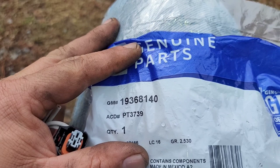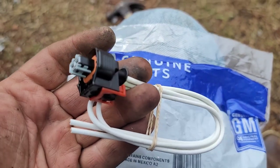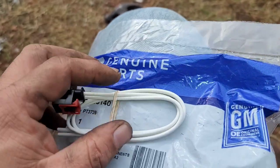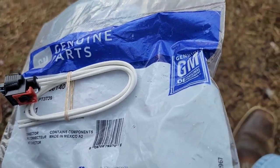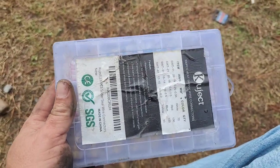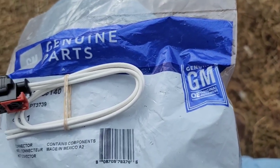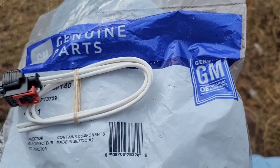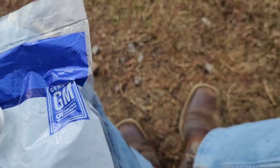Here is the injector connector — the pigtail, whatever anybody wants to call it. I catch some slack every now and again because I call it a connector and not a pigtail. Potato, potato — same thing. It comes with the butt connectors that have the shrink wrap butt connectors in the pack with it, and that's what I've always used. I hate to swap if something's doing me a good job, but I made a bad crimp earlier on the number one, so this time I'm going to use these. I've used these on plenty of stuff before and they seem to do a pretty good job — I'll leave a link to them in the description.